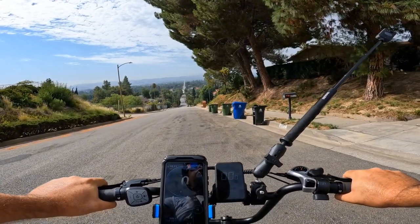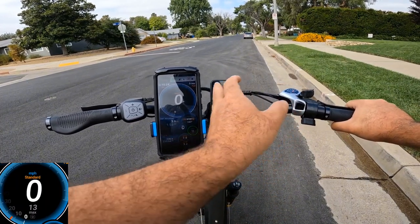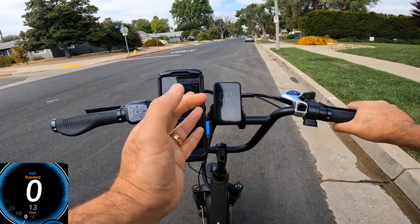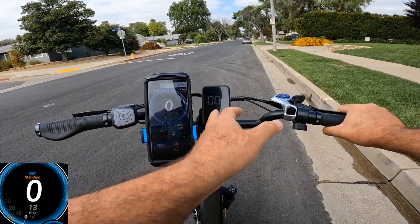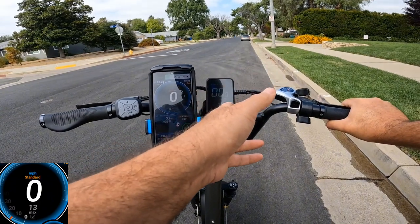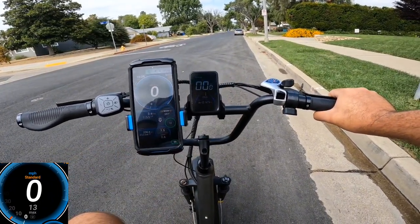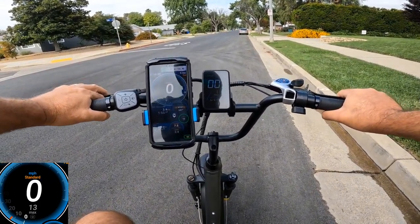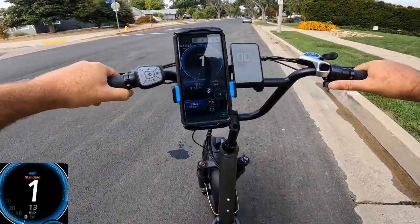The torque is working pretty good. After the first speed test I contacted Senada Bikes — they gave me the password code which is 1212. I went into settings and changed the wheel diameter because it was set to 29 inches, which is incorrect. I set it to 24 inches to see if the speed reading becomes more accurate.